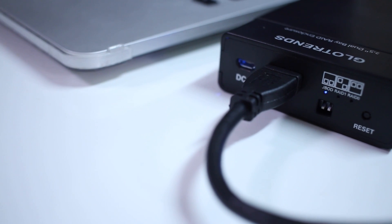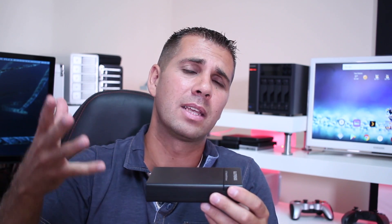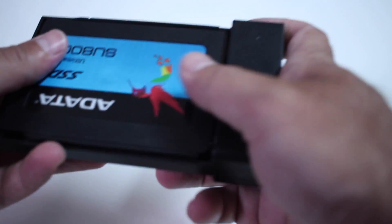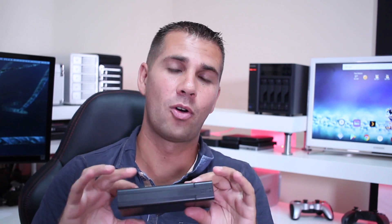In conclusion, this is an interesting solution for someone looking for a portable external storage solution that also provides some data safety. Honestly, I would not use this in a RAID 0 configuration because UASP support already gives us the maximum speed of any SATA 3 SSD over USB 3.0. But I do see the advantage of using one SSD and one mechanical hard drive — one for fast transfers and one for storing more data — or a RAID 1 configuration where we have a backup across two drives, so if we lose one we still have the other. In terms of portability, I do find this enclosure interesting, though it depends on your usage and mobility needs.